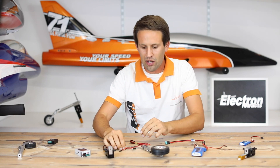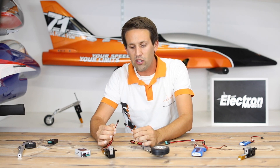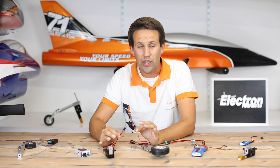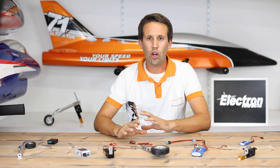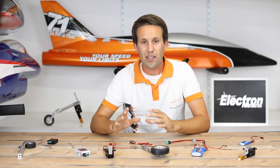Number three: don't join wires. It may be tempting, if you have a Futaba connector using two of the three points and another Futaba connector using two of the three connecting points, to try and put them into a single Futaba connector and join the negatives or positives together. However, you should never ever do this, because each one of the two systems runs completely independent from each other. If you join any of the wires with each other, it will short circuit the whole system, destroying most likely the controller and the Retrax, and possibly even the brakes. The wires are provided as separate, independent connections for a reason — leave it that way.